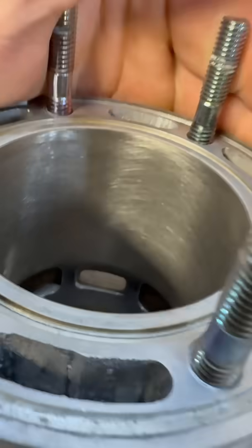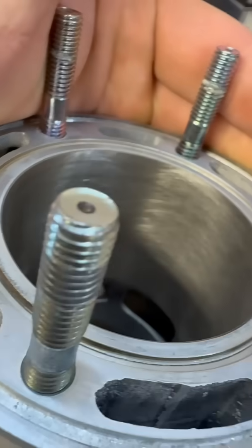Nothing significant. I'm looking for vertical lines as well — there's nothing significant. On a lot of cylinders, especially higher hour ones, you will see vertical lines. Usually, if you can see the lines but not feel them, you're okay. Next, what I'm going to do is check piston clearance and ring end gap on both the old piston and the new one to see how much wear is on the piston and on the cylinder. I have a YouTube video on my channel with more details on that.